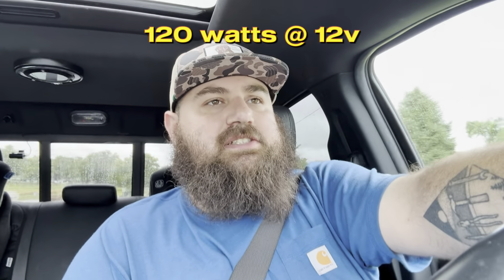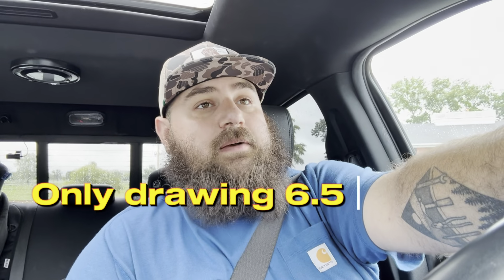In my case, I just used quadplex automotive wire, 16 gauge. So that's enough to carry about 10 amps, give or take, which is plenty. What, almost 80 watts for both of these? 38 times 2. Yeah, so it's just 76 watts.